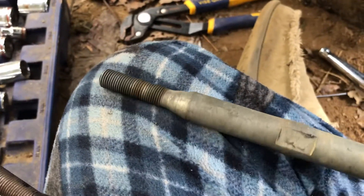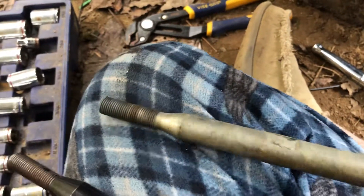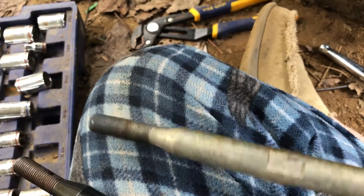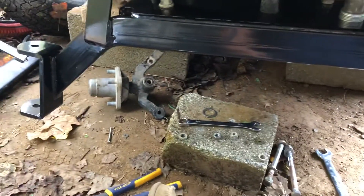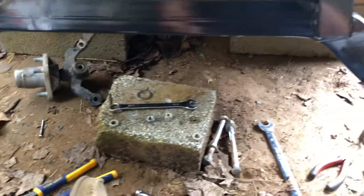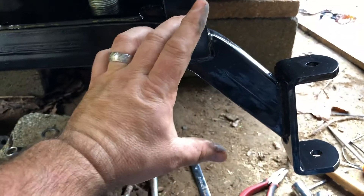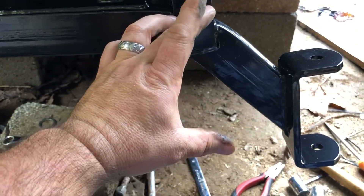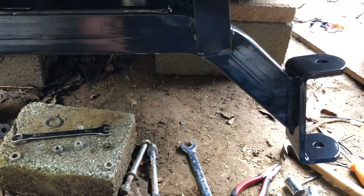I know, don't laugh at me too much guys — I'm down here working in my pajamas. But yeah, even that end I noticed was really bent when I started to take the tie rod end off. It is a good idea guys, when you're ordering this kit, to get the drop-down kit. They're inexpensive, and I know it takes longer to take all this off and put it on. But it's way better than just the spindle drop — even the Jake's spindle drop. It's way better than getting any type of spindle drop.